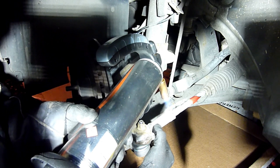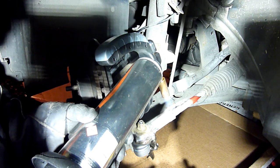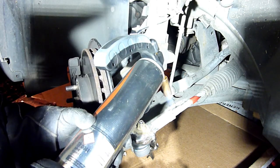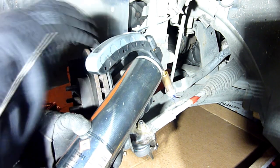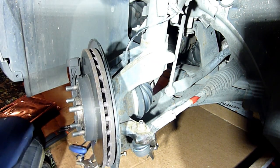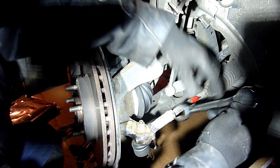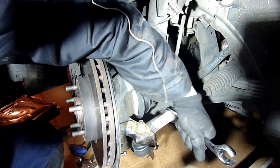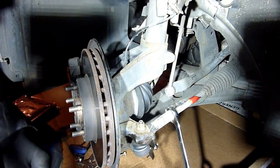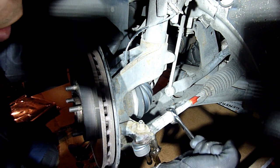I haven't got that kind of thing. Keep it away from the rubber boot of the steering — notice I'm pointing it away from the rubber boot. Whilst it is quite hot... heating up the tracking end joint and pulling it back up. I've clamped it. Just turn — okay, job done!